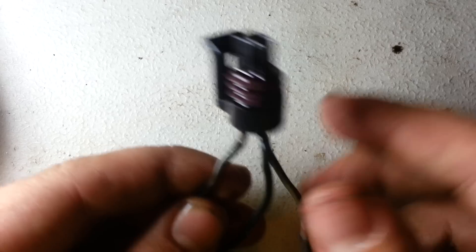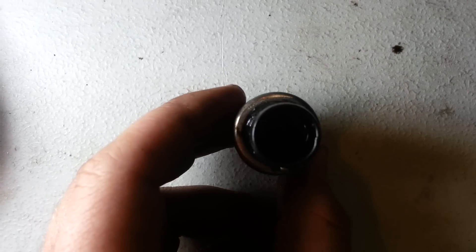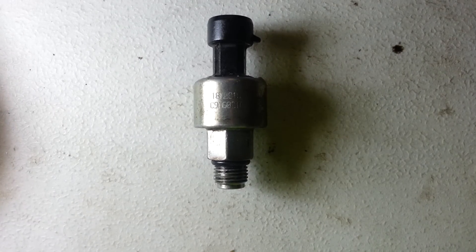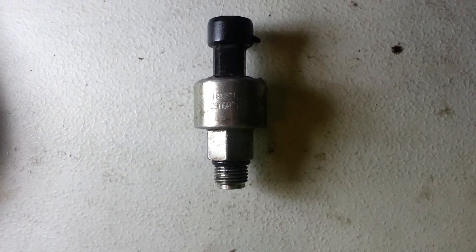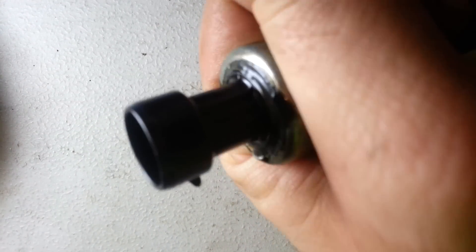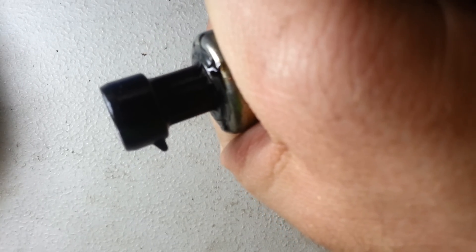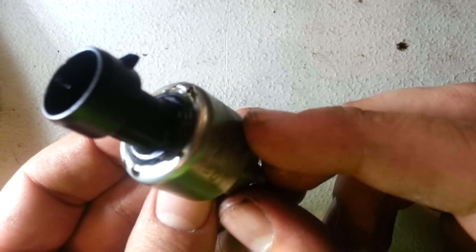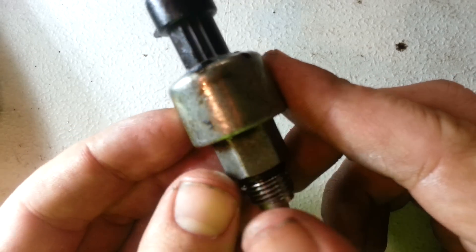Anyways, I decided to see how my sensor itself was doing. So I decided to add some air pressure to it to see exactly what was happening. Now, it's not as much as the engine produces, but it's enough to show. You see it coming out there? See it bubbling out? That's just adding some air pressure, making it bubble out like that — just that little bit of air pressure shows how much oil can seep out in that little bit of time.